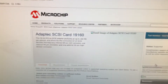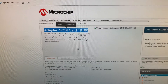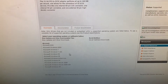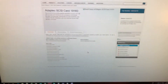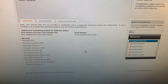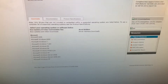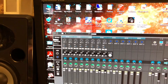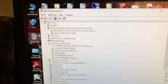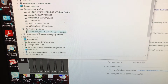After that, you want to download these drivers — you can Google 'SCSI card 19160'. On this page you can see that Microsoft Windows 7 x64 is supported, and basically that means Windows 10 x64 is also supported. Download and install these drivers, reboot your system, then go to My Computer, Properties, Device Manager.